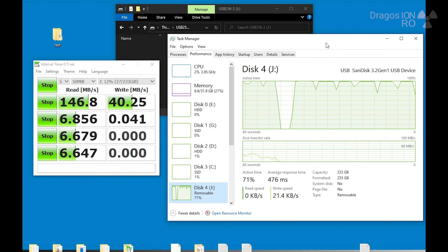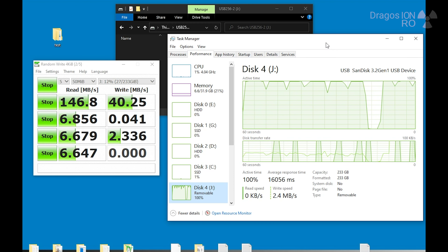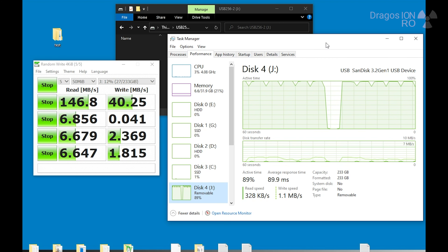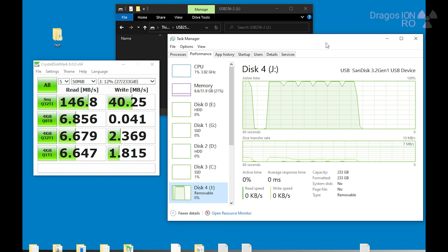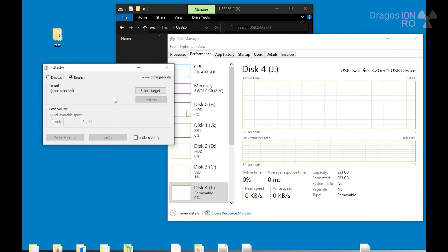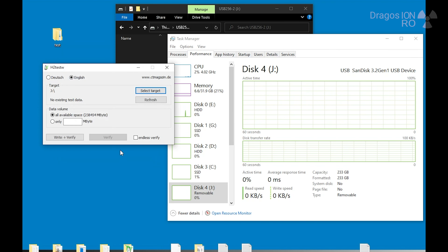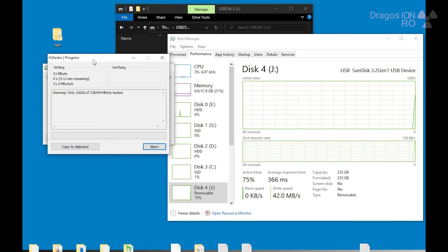Trying it on the computer — when you get it, it comes with the FAT32 file system, which I guess offers greater compatibility, but you should format it to exFAT, which is the most preferred way. The reason is, if you have big files you want exFAT. This happened to me — I had a lot of files on it and when I tried to copy a big file, FAT32 wouldn't let me. So I had to copy out all the files, format it, and then copy them back.